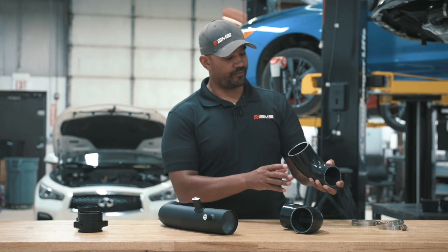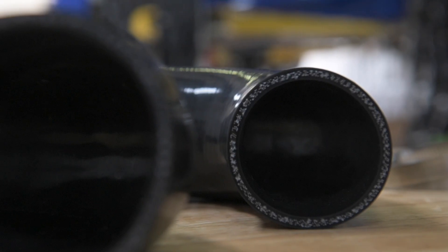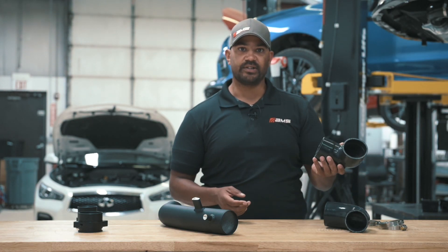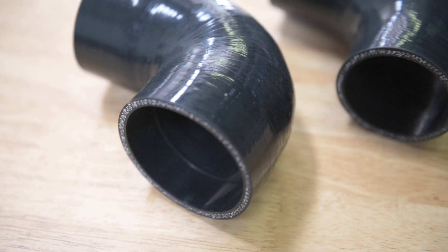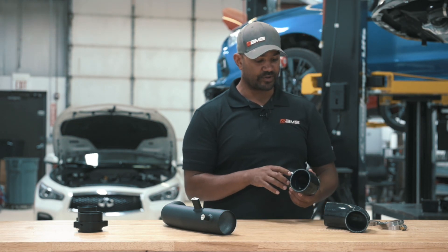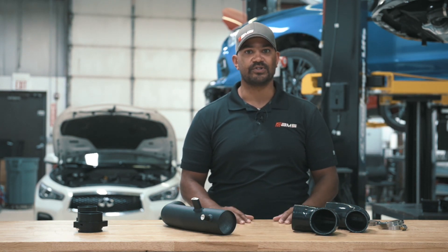This is our coupler coming from the turbocharger. It starts out at about two and a half inches up to three, with a nice smooth 90 here — actually it's like 95 degrees. And then our 90 into the intake manifold, which is actually more like an 87, has little steps in it there and there. That allows us to make the transition internally very smooth as well — just trying to reduce that pressure drop as much as possible and increase efficiency in the system.